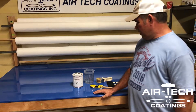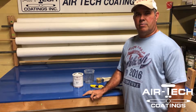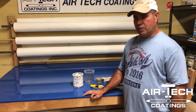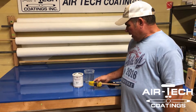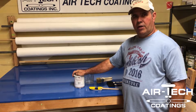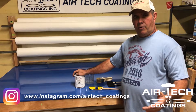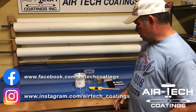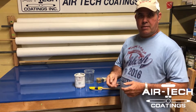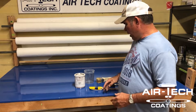It's Fabric Tip Friday again. This is gonna be one that 98% of y'all know, but these are for the new guys mainly — hopefully some old guys may pick up something on it. It's about picking the brush to use for your glue. Our UA 55 glue is thinned with an acetone-based thinner, so it's petroleum-based. You don't want to use a plastic black-bristle brush because it could melt those. You want a natural bristle.